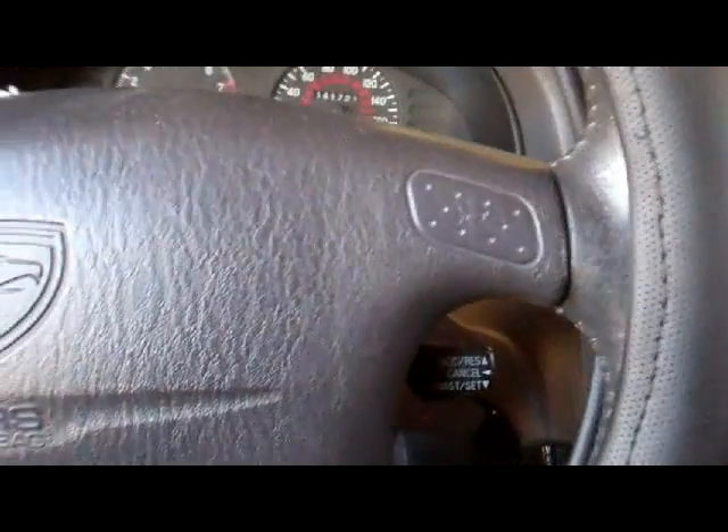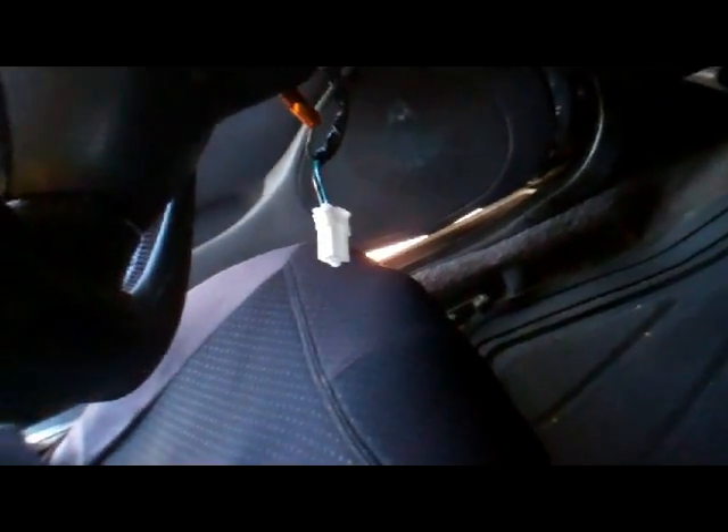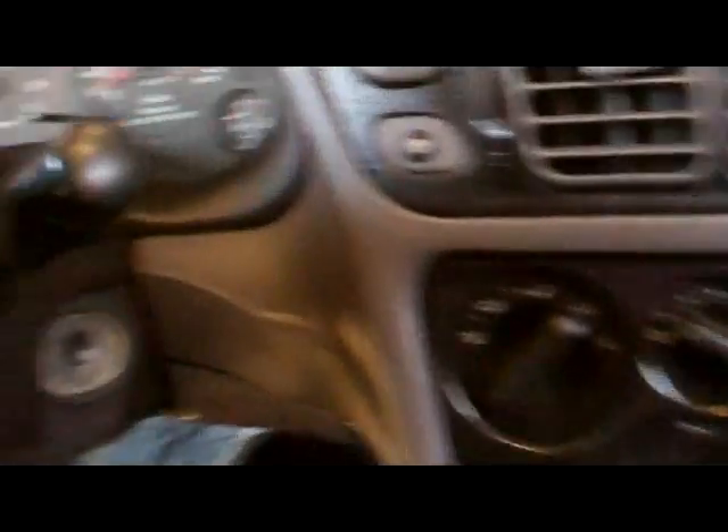So it's been an hour or so. Under the wheel there's a little piece that pops off, and there's a connection for the airbag you can take off as well if you want. So the first thing you want to do is remove the four bolts — one's right here, one down there, and the same on the other side. Just those four. It's going to be a ten millimeter bolt.